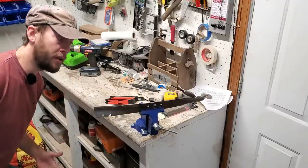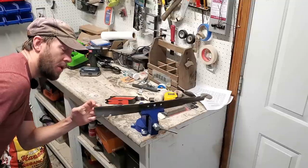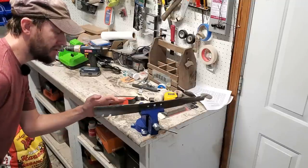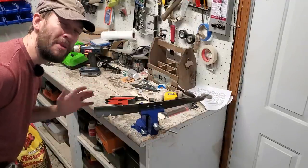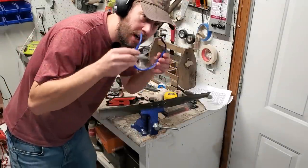It doesn't take very long to make this really sharp. I'll have to go a little bit further to knock some of these burrs out, pulling more material. I'm going to flip the blade over to the other side, but then we have to put it on the balancer to make sure everything is balanced. Filming a video — I almost forgot eye protection.